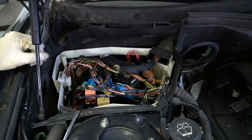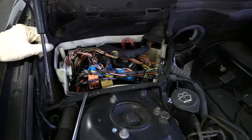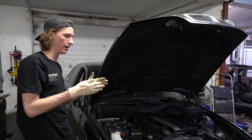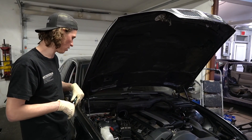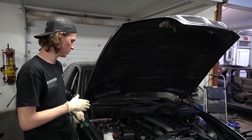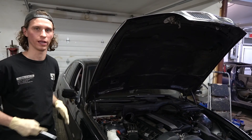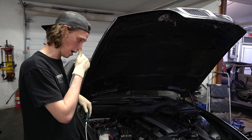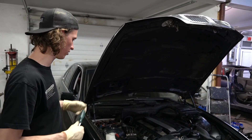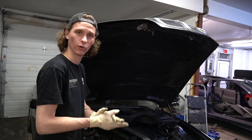Let's try to start it and see if everything's working. All right, start it off. So we'll get this DME sent out — or maybe get a replacement DME sent out — and get the EWS programmed. If you don't know what EWS is, it's basically the key recognition module that makes your keys, locks, and computer all one unit — that's pretty much your car's identity. So we're going to get that all sent out and programmed, maybe get a key cut as well because I know he wants another key made, and then I'll get back to you guys with another installation video and a follow-up of how that worked out. As always, thanks for watching — until next time.